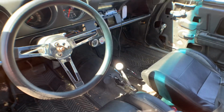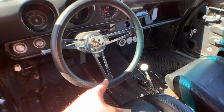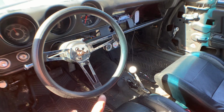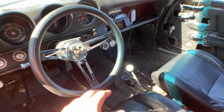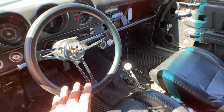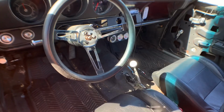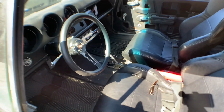Now that we've established we're getting a 454 big block on this thing, transmission: we're gonna keep the existing crappy 3-speed on this thing to break in the engine and granny drive it for a couple of months until I feel like it's been broken in properly. And then it's gonna give me some time to find a Muncie 4-speed. I'm trying very hard to look for an M22, which is what you want for a big block. But I'm probably gonna find an M20 or an M21, and we're gonna put it on here, and it's gonna be a 454 with a 4-speed manual transmission. There's a couple of things you need to do for the pedal and the Z-bar and all that stuff to turn it into a manual, but all the parts are available.